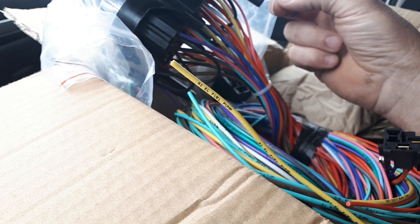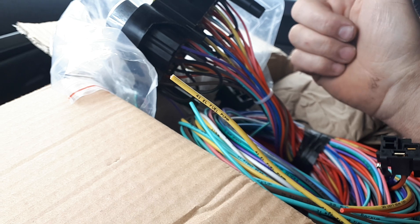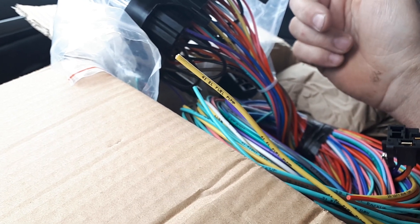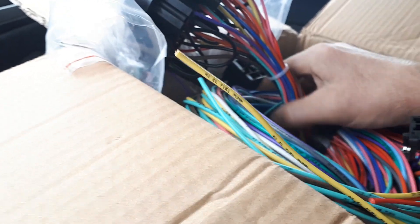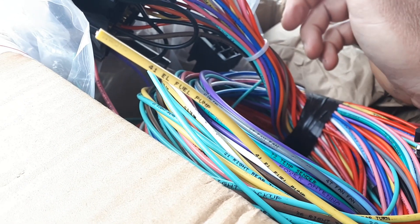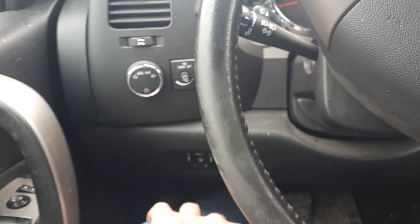I think I've got to replace the heater fan motor — that's got to work to pass safety. Then I need to get the dome light working. I'd like to hook it up like my old '78 Buick where opening the door grounds the circuit and the light comes on. This wiring harness is actually set up that way — the light always has power and gets grounded by the passenger door, driver's door, or by the switch knob. I might delete the switch on the light itself.